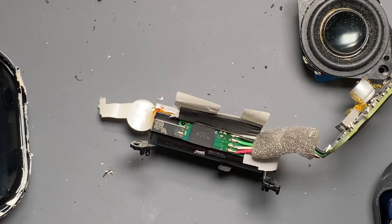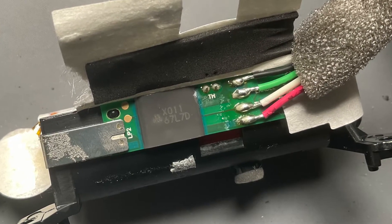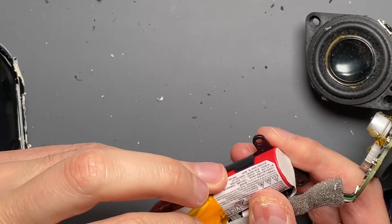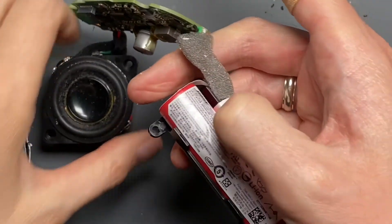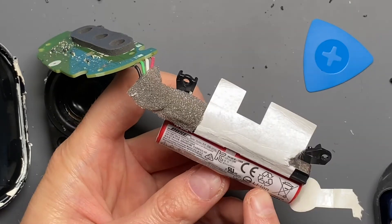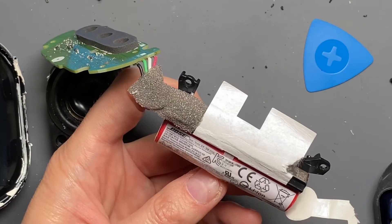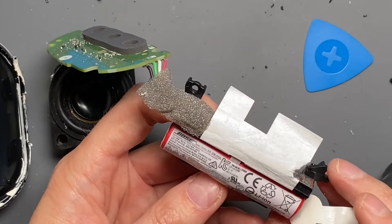I think there's a thermistor embedded, and it looks like TH with two little pins on the silkscreen. There's a flexible element embedded in this — it's covered with polyethylene film tape over the battery. It's a battery made by Panasonic Energy Mexico. It is a rechargeable lithium-ion battery pack, nominal voltage 3.6V. The battery is 2950 milliamp-hour, 11 watt-hours. It does charge to 4.2 volts, but the nominal voltage is slightly lower — I think that helps with a bit more longevity in the cell.